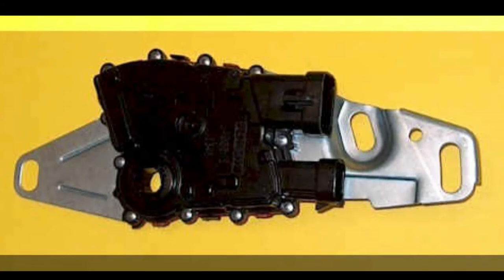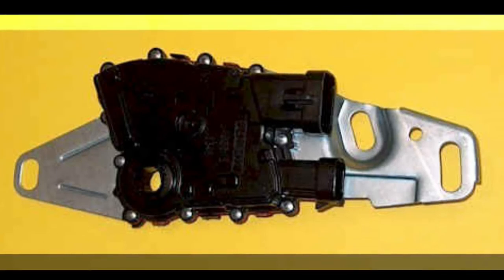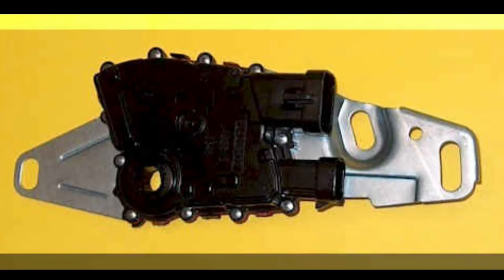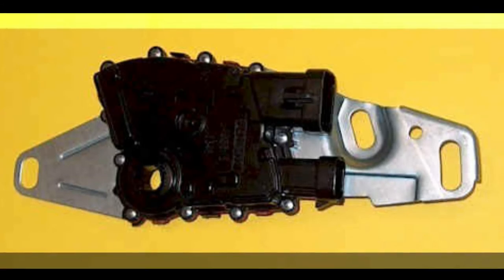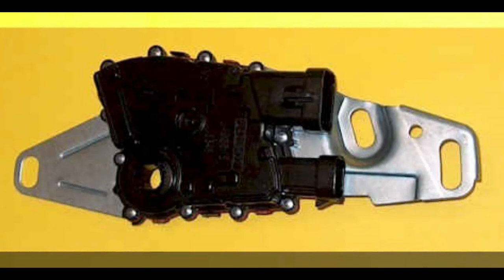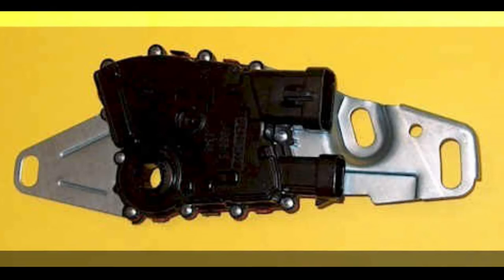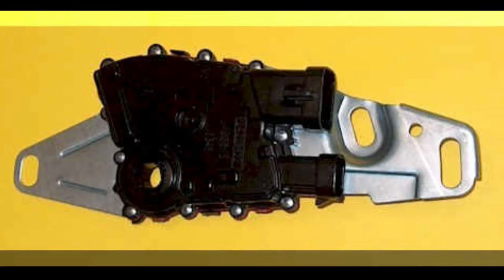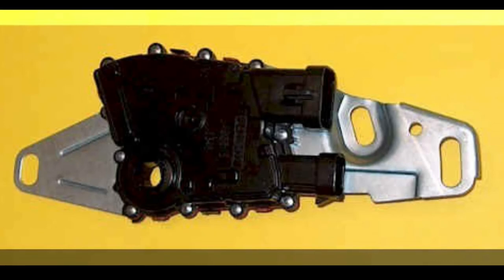If you can, take some wire cutters, follow those wires off that range selector, go up about a foot to a foot and a half, and cut them up there. This will make it so you can get back to the house, take your time, and apply some heat to that plug — which is generally what breaks it loose — without tearing up the switch. Everybody breaks the switch; there's a very low survival rate on those switches. Do yourself a favor and don't break yours.